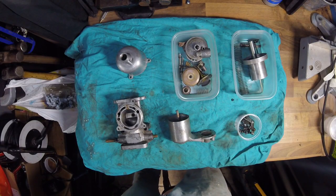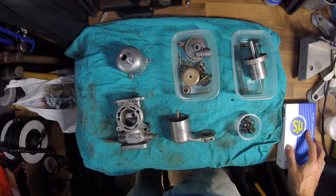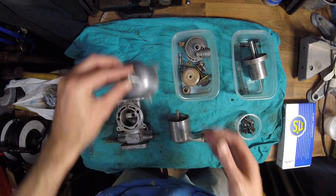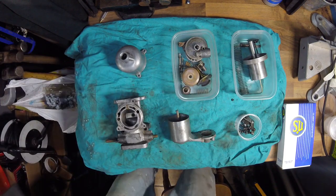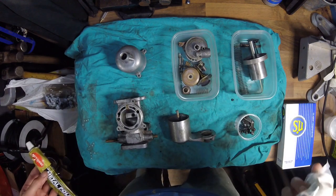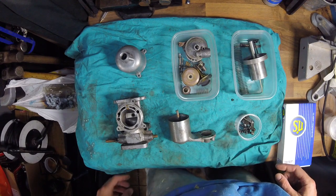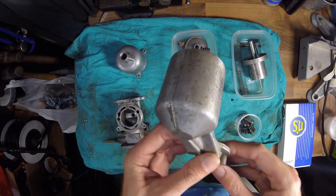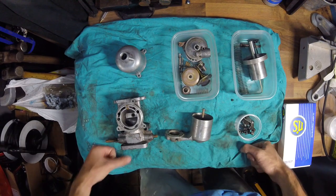Now that we've got the covered part, we could just fit all the service components and job's done. But we're not going to do that - we're going to give these guys just a nice quick clean and a bit of a polish. Using some fine sandpaper and then buffing off with a bit of aluminium polish and some buffers, just to get them looking nice. It's not going to be a show car, so we do like a little bit of patina, but these ones are looking pretty hammered - so yeah, we'll give them a quick clean. Let's see how they come out.